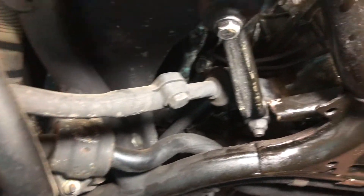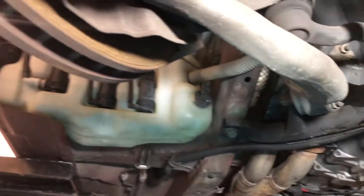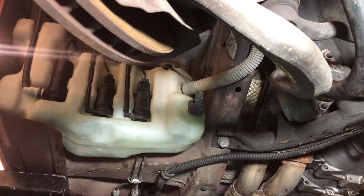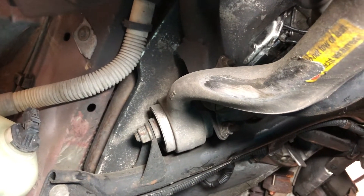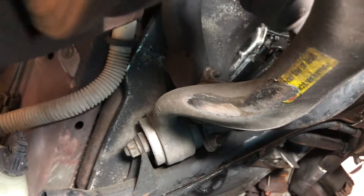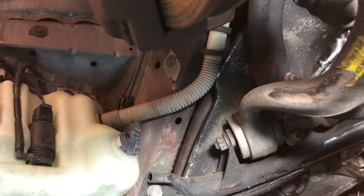So don't feel like you can just grind this thing totally away and somehow get a ton of angle. The other issue is that the tire will hit the back of the wheel well. I don't even have any wheel wells on this car, but that's the fill line for the washer fluid tank and that'll get a hole rubbed in it. You can also see on the outside of the thrust arm where the tire has contacted it. So don't go crazy and get big wide front tires because you'll end up just rubbing the inside of the wheel well pretty good.